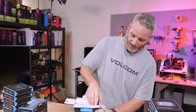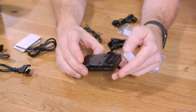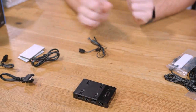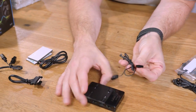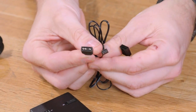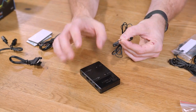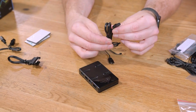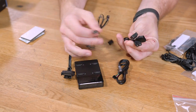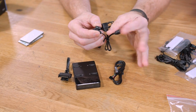I know I'm already talking about a controller, but this is different — trust me. This is everything that comes in the three-pack. Here's the control box. Each control box has four groupings. These are the three fan connectors for the fans. There's a fan tach wire — if you have all your fans connected to this, you still need to tell your computer the fans are running, so this plugs into the motherboard. This also plugs into your existing ARGB header on the motherboard, presumably so you can control it with Aura or something like that. It also has its own software and comes with its own USB cable so you can plug it into a USB 2.0 header to control the box. Here's the single power connector, and here's an ARGB splitter so that if you're taking up your header with this, you can split it off — one going to the motherboard, one to this device, and one to another ARGB device.